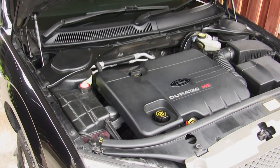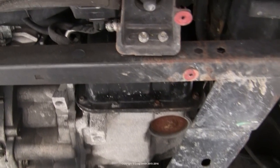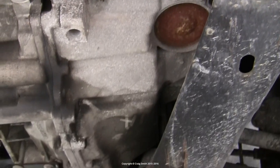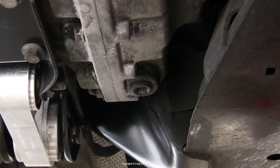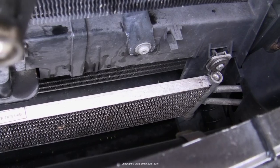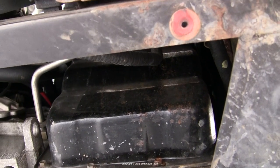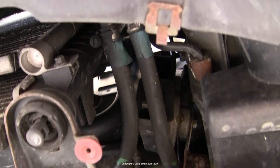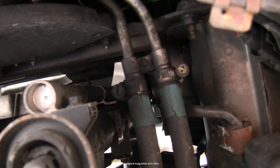This is mounted to a Ford Duratec HE 2 litre petrol engine, but that doesn't matter — the gearbox is identical regardless of what it's plugged into. You can orient yourself with this black painted valve cover. Going from there back along the underside of the gearbox at the rear end, you will find a square socketed drain plug, and we will be working with that today. If you look around your car's main radiator, you should find the transmission oil cooler. You can follow the hoses from the gearbox itself, and at some location you'll find two hoses which run together — we will be working with these because one of them will be disconnected in order to drain the majority of our oil out.